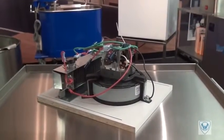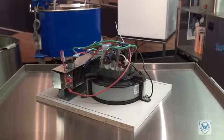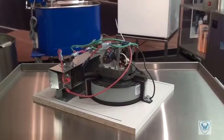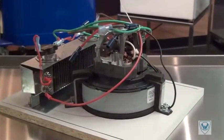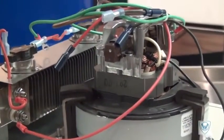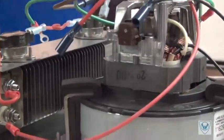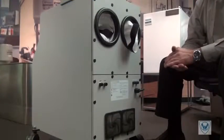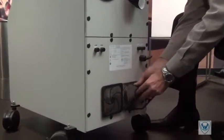One of the other features of these thermotherapy models is the addition of a motor board. This board allows for quick change of the motor, as the motors do go bad over time. The life expectancy of the motors is 800 to 1200 hours. The life of the motors can be extended if you keep the filters clean, which can be done by simply removing the outer cover and washing the filter clean.